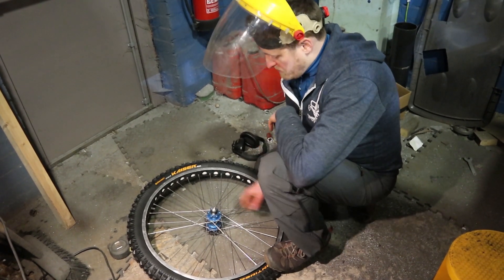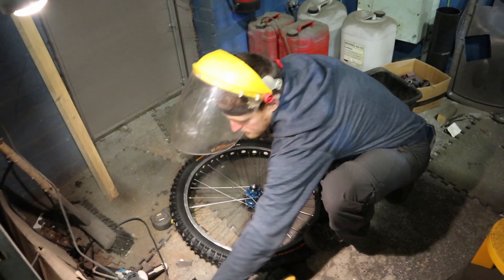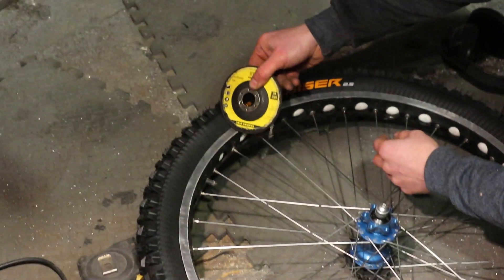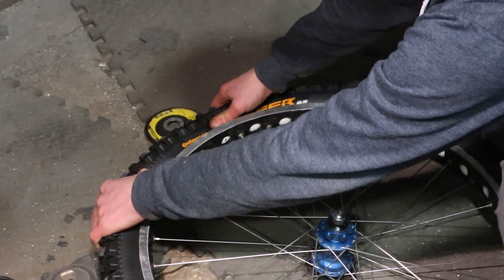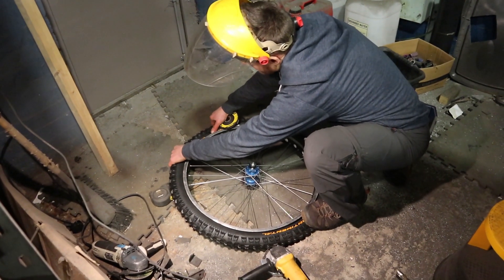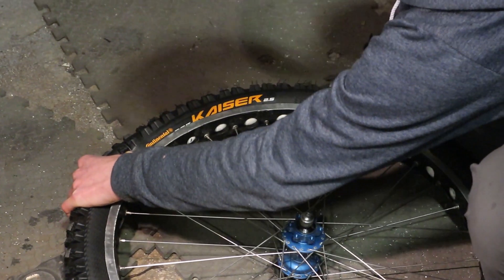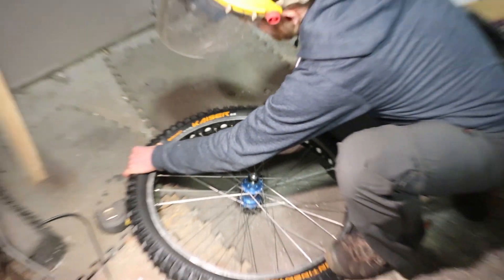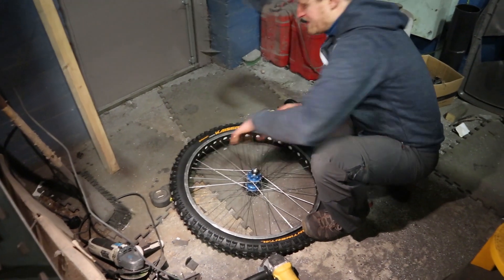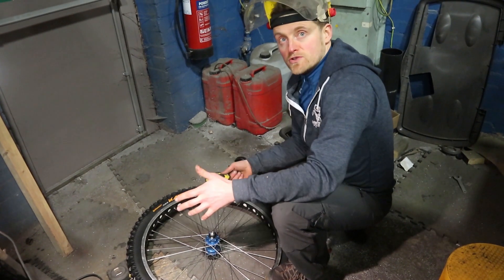You can give it a quick freshen if it's wet or muddy. The key is you need to get the tyre out of the way of the grinding disc, because it will come in and you'll be cutting into your tyre. So you squeeze it out of the way - much easier with newer thin sidewall tyres. As long as you can get it far enough away that you're not going to touch the tyre with the grinding disc, you should be fine. The only thing is you're working quite close to your spare hand, so you need to be careful. We can't really professionally recommend this, but it's the way I would do it given my experience and confidence with using these tools.